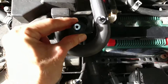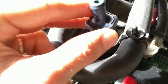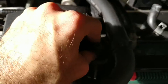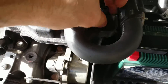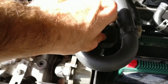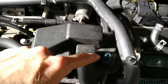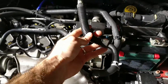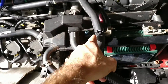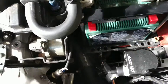Here's the piece that I took out. That's where it screws in. It was a one-way valve, but I drilled it, so now you can see right through it. I'm going to put that back in there. Just because I unscrewed it with my hands doesn't mean that you can — I already loosened it up with some pliers. Also, here's the hose that we're going to be replacing. This hose is the one that used to go right here — that's the one we're going to take out. It's going to go from this nipple to the in of the catch can, and then from the out back here.